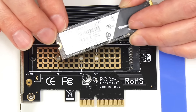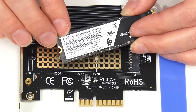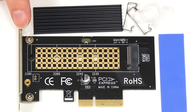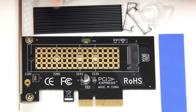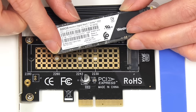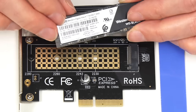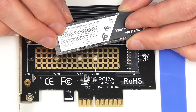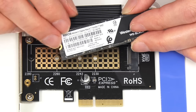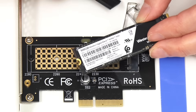Here our drive and the PCIe slot we're going to fit this card into are PCIe 3.0. So even though this is a PCIe 4.0 adapter card, the theoretical maximum speed the drive will operate at will be just under 4 gigabytes a second. Hence a heatsink is not essential in a well-ventilated case, although if you've got a heatsink available it's always worth fitting it. That said, I'm not going to be fitting this heatsink on the drive right now, because this is just a quick test.